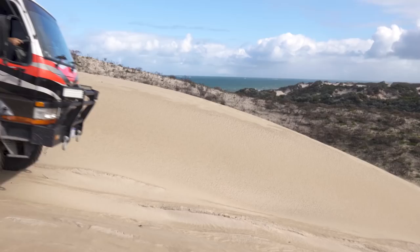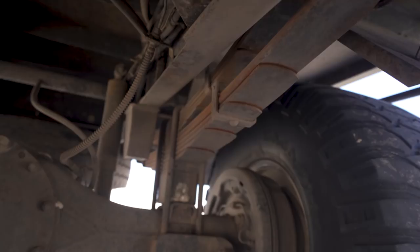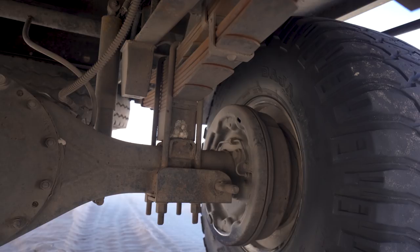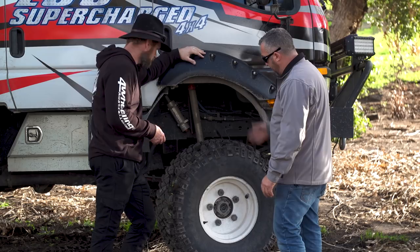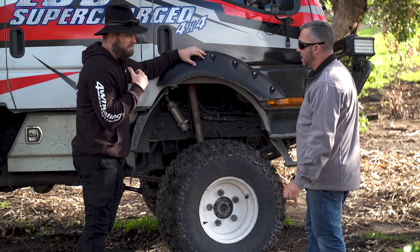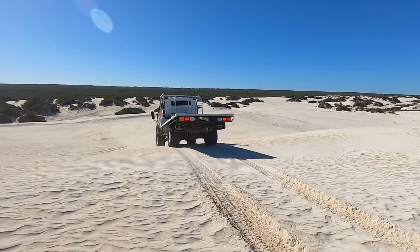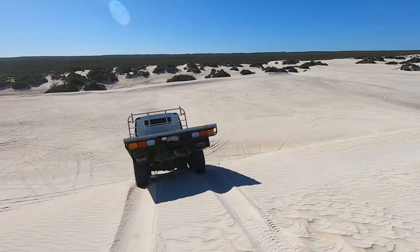Let's talk about your suspension and the ride. It's quite heavy in the rear but it seems to handle it well. The suspension is still standard Mitsubishi — I've lifted it up a little bit because normally you've got very little bump stops, so I've given it some height. I've just upgraded the shockies to give a bit of a better ride — it's a remote reservoir shock with the canister here. I've had the shocks on there for about two years and it still feels good. The fronts are different — the backs are just standard Mitsubishi. When it's unloaded it might be a bit more rigid but I don't really feel it from the cab.